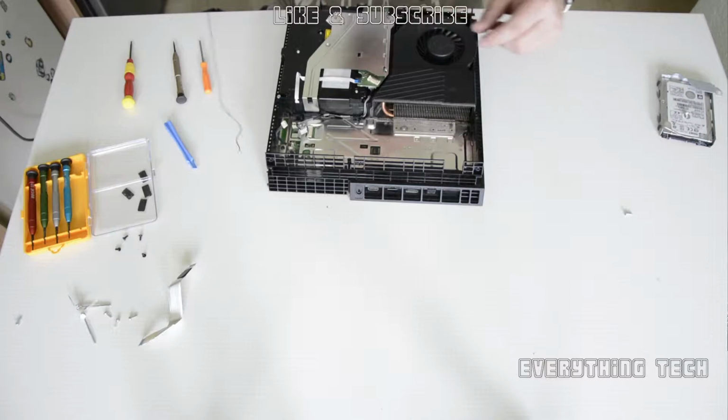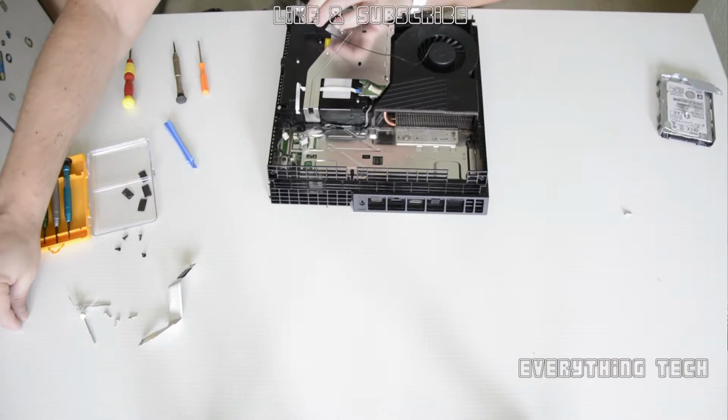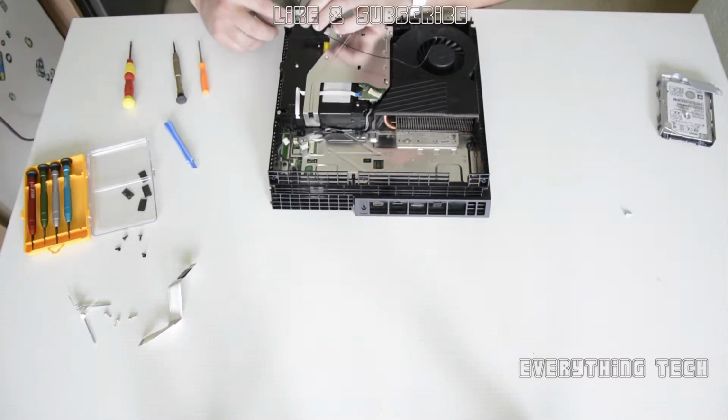It's now under the hooks. Now we can put in the antenna bit, guide it up to the grooves on the housing. So put in the antenna and the plate at the front, and then screw the T8 torx screw on top of it, securing it to the housing. And finally you can route the cable over to the front and connect it to the motherboard at the back under the power supply.